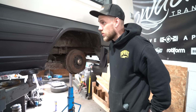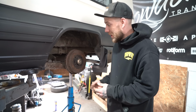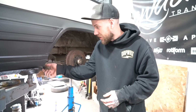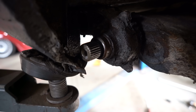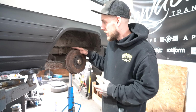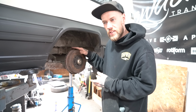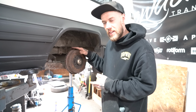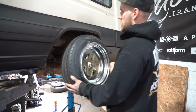To recap, for those who have a Renault Extra, Renault 5, I think they're all the same. Basically what I've done is knocked that bar so it's come out. I'll insert a little clip here so you can see what I mean. And then I've literally now just jacked this up. Now, that was 14.5 hanging. I've jacked up to 40. It says 4-inch drop. Even though if I put a wheel on, it doesn't look low now.